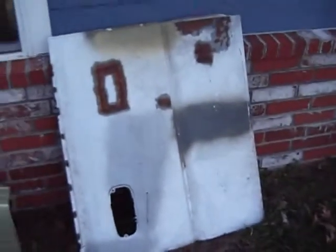This stuff here is pretty good. I didn't do any welding on this — this was just bare metal, and I shot it on top of it. This has been out with UV rays and everything, and it's still holding up pretty good. Rattle can is the last resort, but on some stuff — small parts and stuff like that — that stuff's pretty impressive, really. Like I said, 3 years sitting out in the weather, snow, rain, everything, and it's still held up this good. And all this is bare metal and I just did the welds through here. If I'd have treated the back side — I wish I'd have done one of them like that, that way I could see for sure. But you can see the rust is starting to come back through the little beads from the back side. And again, I don't think it would have had I treated the back side of it.